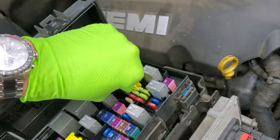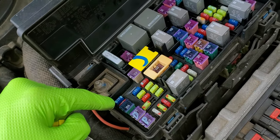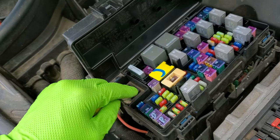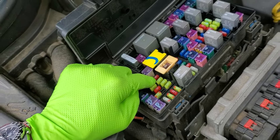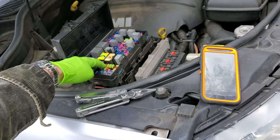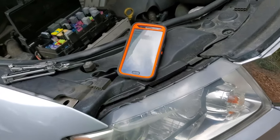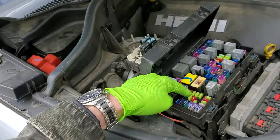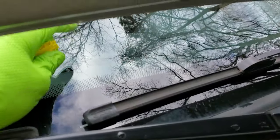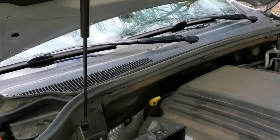There are other fuses as well over here. This 15 amp fuse, among other things, does provide power to your headlight switch inside the car. And this 10 amp fuse does two things. It provides power for the headlight leveling system, sending power directly to your headlight assembly. It also provides power for the solar sensor, which is located on the dash — basically how the car decides whether or not to have the daytime running lights on.